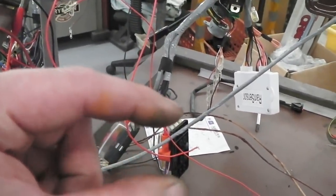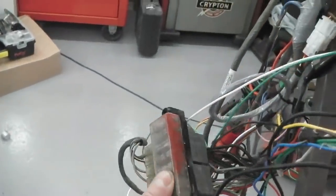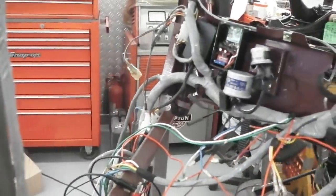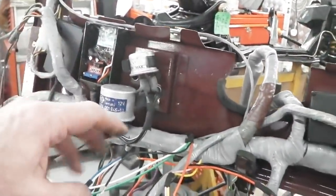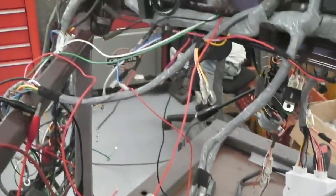So you've always known that if that fuse blows and the indicators don't work, you only ever have to look at the fuse in the forward one. You don't have to start saying, hang on, is it the hazard fuse? So that's it. It doesn't interfere with the wiring. Again, it's simply piggybacking across. And as I say, the little chip itself, separate of course, goes into one of these auxiliary fuse boxes. We'll wire it in now and test it out.